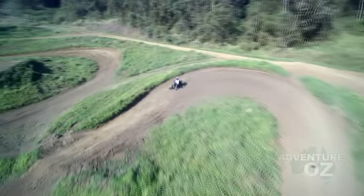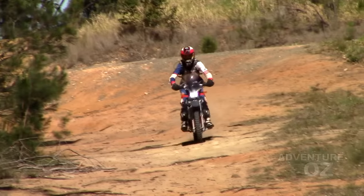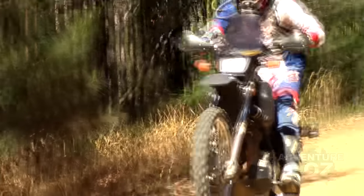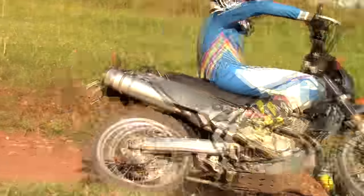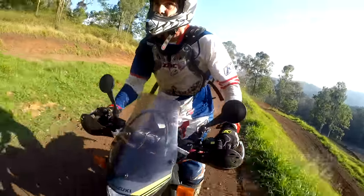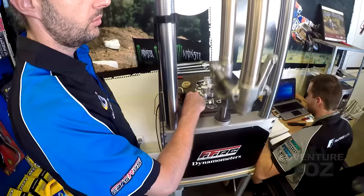It's hard not to rave about how different the DR feels, with that smooth plush ride on easy tracks right through to the most challenging terrain you could imagine. FFRC's dyno and real-world testing suggest most riders will find the Plex valves will suit the stock springs for riders up to around 100 kilograms. Stiffer single-rate fork springs would only be needed for heavier riders, a safari tank, or very aggressive riders. The length of the Plex valve compresses the softer part of the dual-rate spring sufficiently to achieve the right amount of sag.